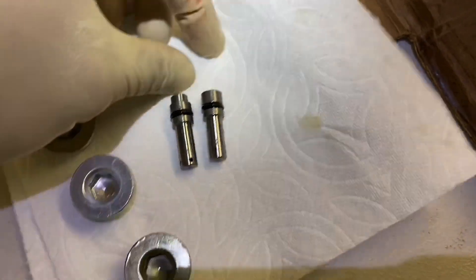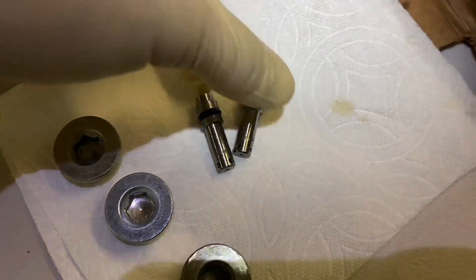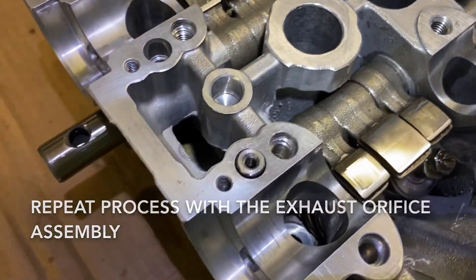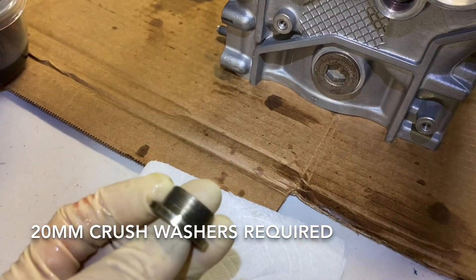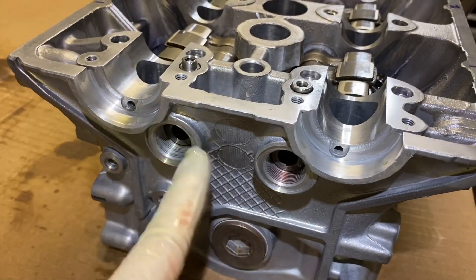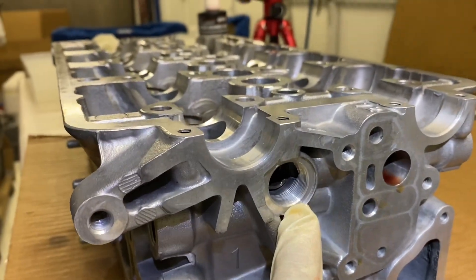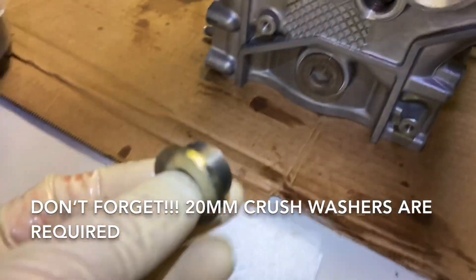There's the hole. Now for the rocker arm assembly orifices: the one with the larger diameter is for the intake, the smaller one is for the exhaust. Take the intake orifice, drop it into the intake side, and push it right in. Then for the seal plugs, make sure you have the correct crush washer on each one. Clean up the holes and threads, then install — there are two on the cylinder one side and one on the cylinder four side. The other hole gets covered by the VTEC assembly.